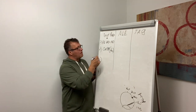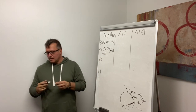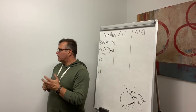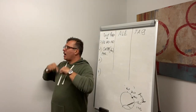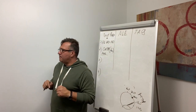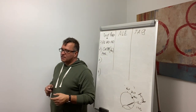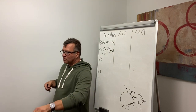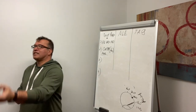Okay, here you need to mention the ABS light. It came on and off. First of all, it's part of the test, you need to check your ABS system. Second, it's a double check for yourself. If you see the ABS light came on and went off, it means, guys, you cut the engine and you put the key in the proper position, accessory.